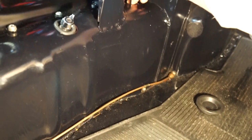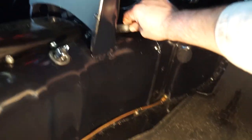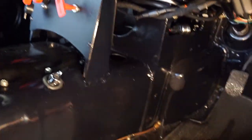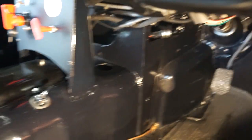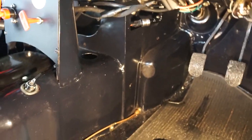Don't put that back in for now. You sort of have to feel around until you get it in the hole, and then the rubber cover just sits back on — I sort of twist it on a bit. That's where you find the dipstick on the car. But as we're going to be draining the oil, let's take this out again. What I'm going to do now is get underneath the car and show you where the drain plug is.